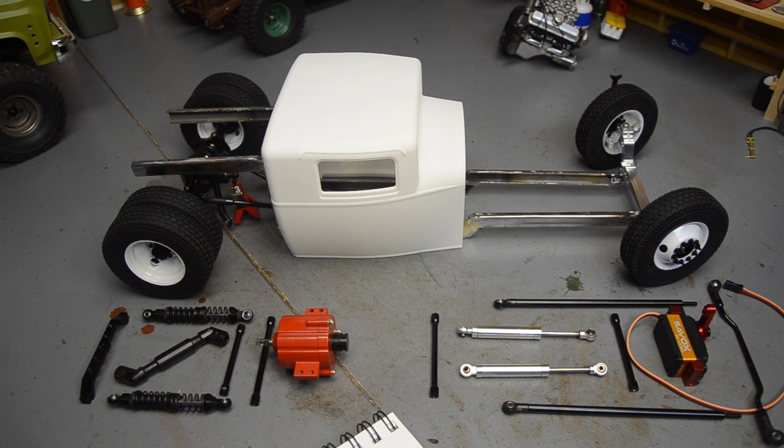This one I want to be a little more precise, since this is what you would do if you were building your own rat rod. You would make a frame similar to this — it would be box tubing most likely, that's what most folks are using — but you would want it square, strong, and parallel. Both sides need to be the same, so that's where we've started here.